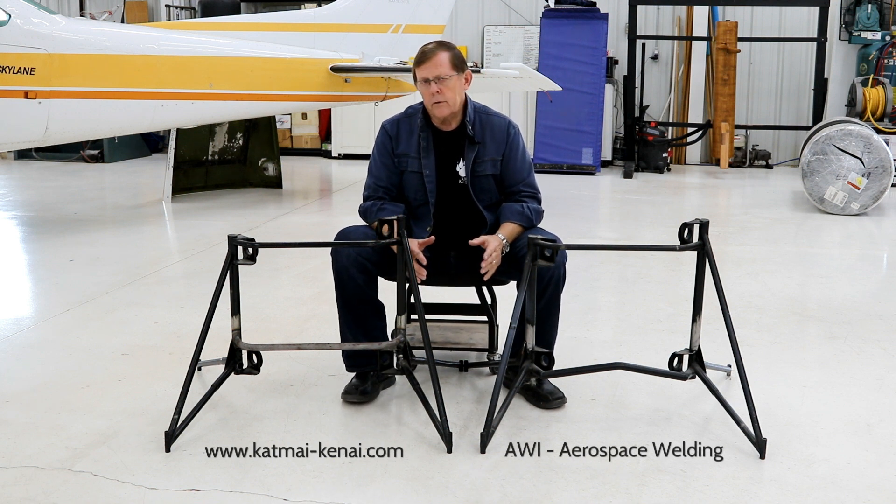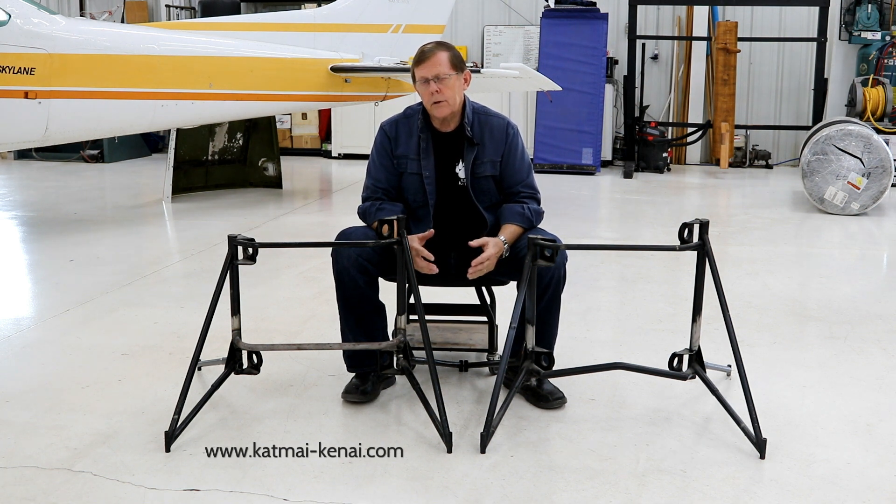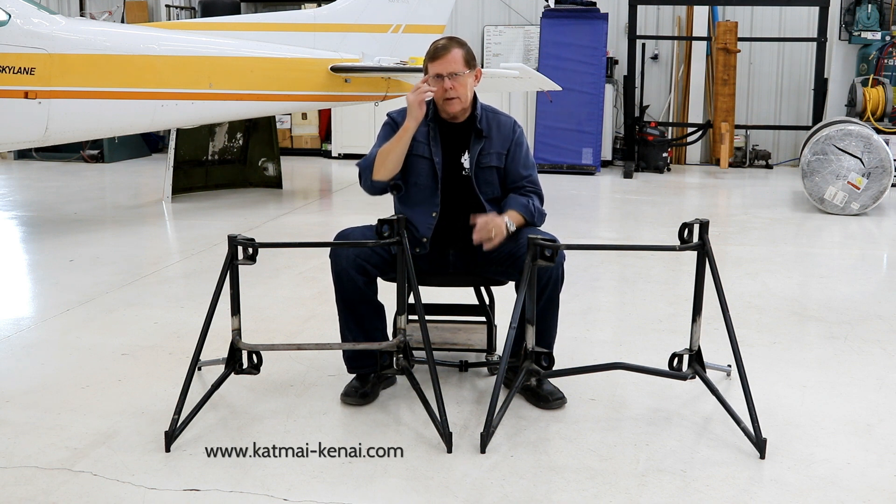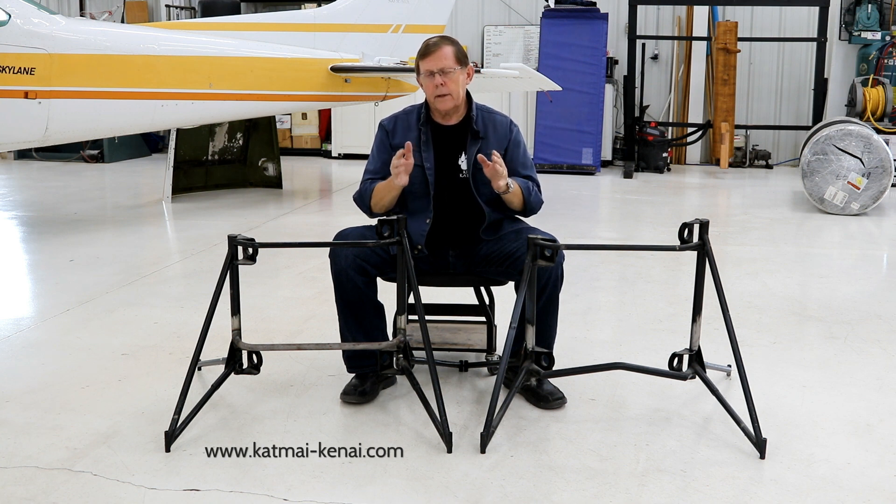AWI has done a lot of work for us. They've got our new prints so they can do engine mounts if you need one. If you have a local shop that you want to do an engine mount with, it's no problem — have them give us a call. We can send a PDF on the modification. Other than that, you need a totally stock engine mount if you've got a canard, because the geometry of the side frames and the clips depend on that stock engine mount.